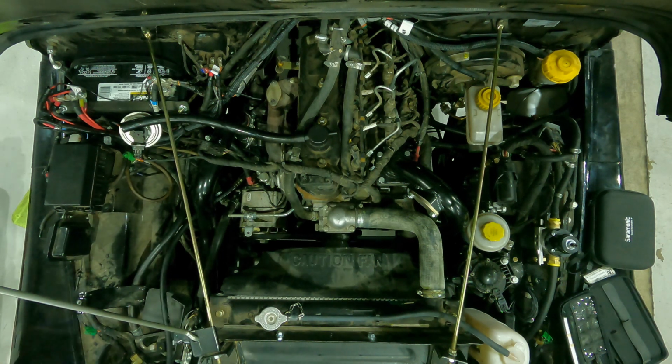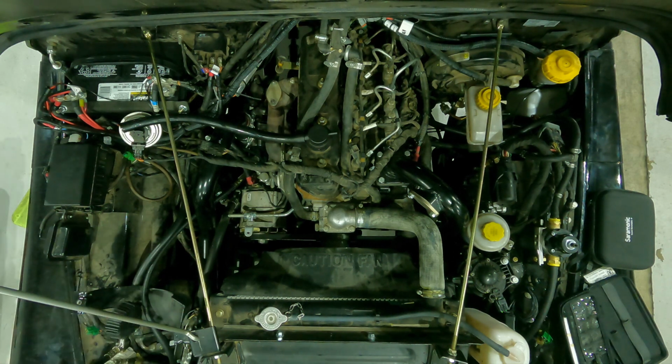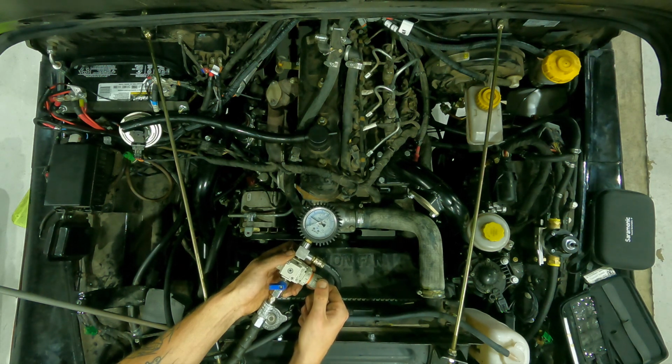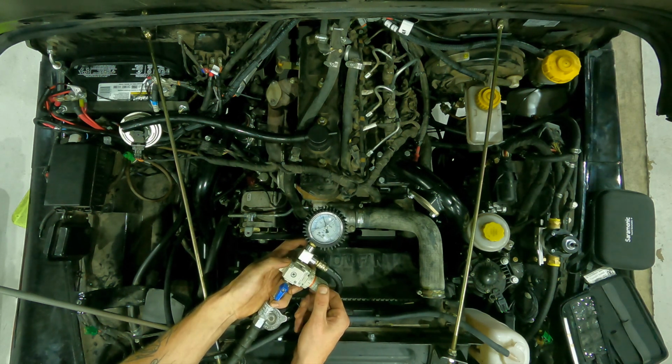And then make sure your valve is closed before you plug it to shop air. Okay. Because we don't know where the last guy left the regulator set to, and the last thing you want to do is send 120 psi through this thing. Jesus. We'll grab our airline. Screw it up. And then should I show this? Yep. So you want to slowly open your valve to get an idea. Unclip your regulator so you can adjust as needed. I like to bring it to about 15 psi regulated, open the valve all the way, and then slowly bring it up.